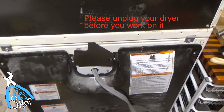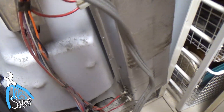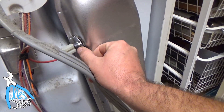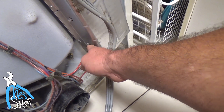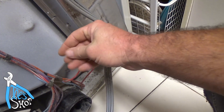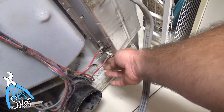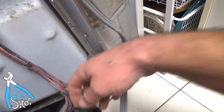We're going to take the back off of this — it has a quarter inch. As I understand it, there are three different things that could go wrong here. The inside has a bunch of wire for a heating element, like a toaster oven. Then there's a thermal fuse, and there's also some sort of thermostat. The thermal fuse should have continuity — if not, it's broken. The thermostat, I can put my hand on it and body heat will increase the resistance; it's a temperature-correlated thermostat. Down here is the main power feed for the heating element, and that needs to have continuity also, otherwise there's a broken wire. So let me get the multimeter.